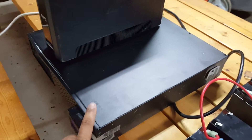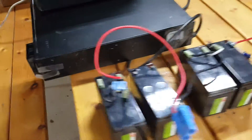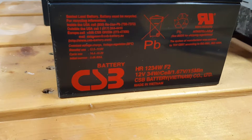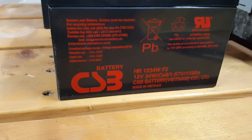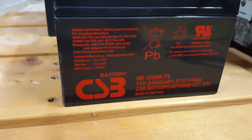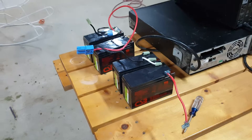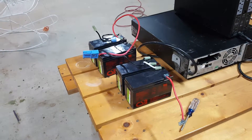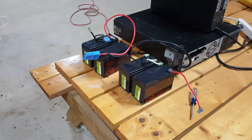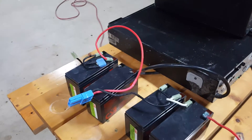I'm thinking about using this bottom one and upgrading the batteries. The spec on the batteries just says 12 volts, 34 watts per cell — not sure of the exact amperage. I want to go with something like deep cycle batteries from Sam's Club or maybe some golf cart batteries, trying to stay in the 100 to 150 amp-hour rating so I can have a 48-volt battery pack with 100-plus amp hours.